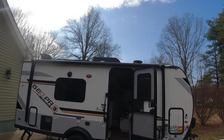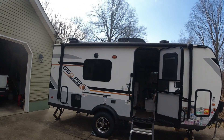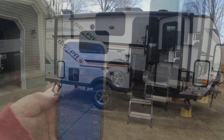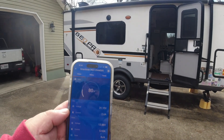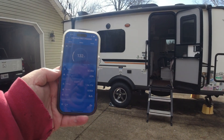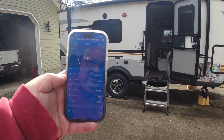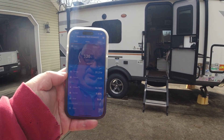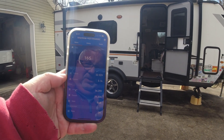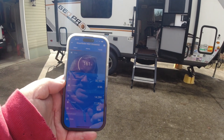For the final check, the blue sky is moving in. It already went from 65 to almost 80 watts and we don't even have direct sunlight yet — we're getting probably about a 38-degree angle on the sun. If it was straight overhead in summertime we'd do even better. And there goes the wattage — as full sun comes across it shoots up to 104 watts, getting up to 4 amps. Then with the sun at an angle it hit 165 watts and almost 5 amps. Really happy with this setup.